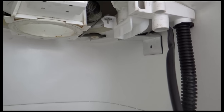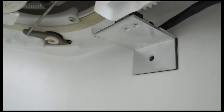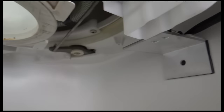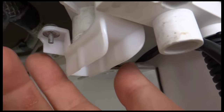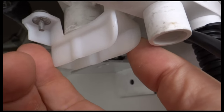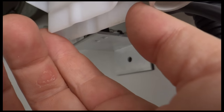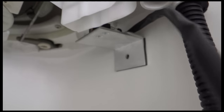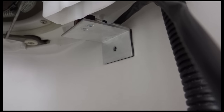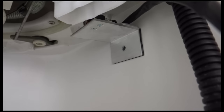Okay, so that was a bit fiddly. I'm not sure I've got it right still. So the switch needs to be down, if I lift it down here, as far as I can tell, it needs to be at the far end of this rotatey bit. So as it rotates round, get my other hand in there, as the switch mechanism's opened, it opens like that, and then you can hear the micro switch. You can't hear it, but that's the only way I can see to get it to work. So I think that's in the right place there. So I've got to drill a hole in here, pop a rivet in, the plastic rivet that comes with it, to make sure it's sealed in the right place, and then hopefully that's the right spot. I'll find out as I put the cassette back in, see if it works.